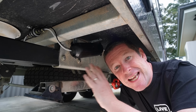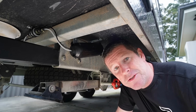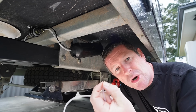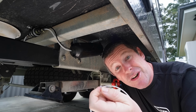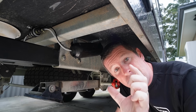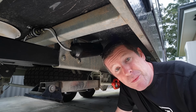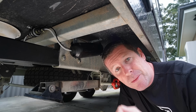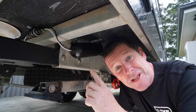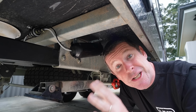Right, we've got our fuel lines all connected up to the diesel heater running through to the tank that we installed just before. It's pretty easy to do. A few little tips and tricks is to use something really sharp with this nylon line so you're not crushing and squashing the end of it. So I tend to use some side cutters that are really sharp, and you just want to make sure that the end isn't all closed up. Now, when it comes to the little rubber joiners, same thing, I use some sharp side cutters on that. You can use a knife or something like that. It works just as well. And a little bit of silicone spray does help to get that in there, but it's a fairly firm fit and I don't think it will leak. I've started to bring some diesel through to the pump, which we'll touch on shortly, but I just wanted to give you a few tips and tricks into running these lines through and getting it all neat and tidy.